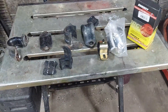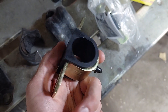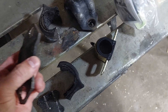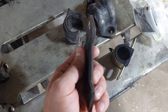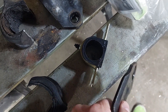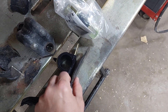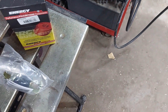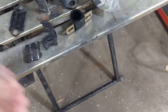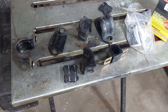These are the new bushings that came in - 33 millimeter, which I think works out to be inch and five-sixteenths. I've been thinking about it and I'm pretty sure I'm going to go ahead and use these plates because that's just a good bit of standoff distance comparatively. Putting these guys up like that, you know, it is a good bit of standoff distance. I'm probably going to have to figure something out though, because as you can see that too is a good bit of distance. You could stack washers - as bad as that is, you just need a little bit of a spacer in there to keep things from deforming and being in the right place.